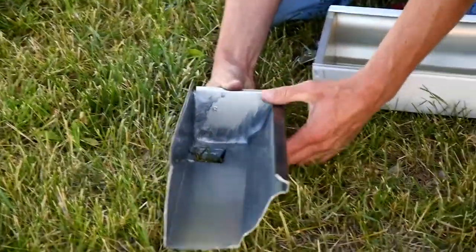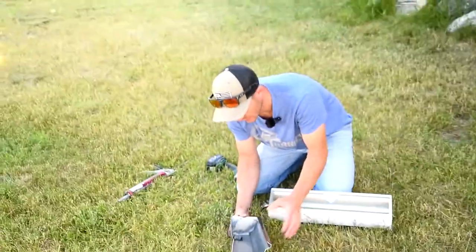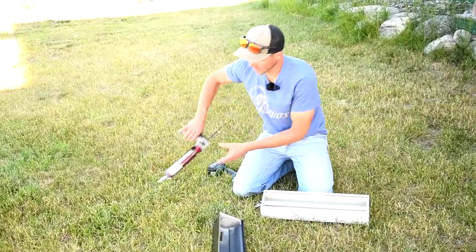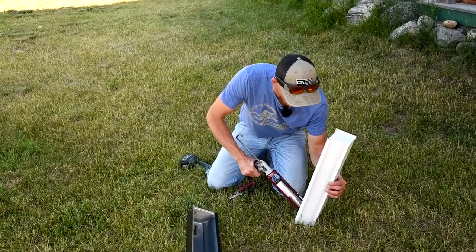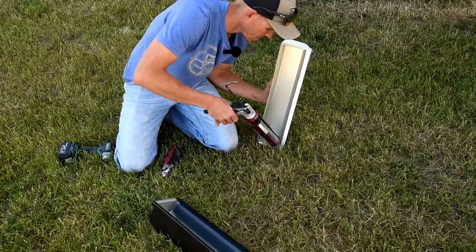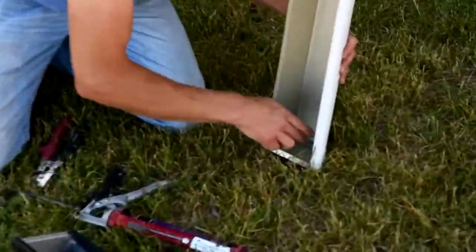So you want to put plenty of extra glue in. You also weld it in with your finger to make sure it's sticking to both layers of metal really well. We'll go ahead and glue this one just to show you how it's done — plenty of glue in there, a nice solid bead all the way. Once you've got a bead all the way in, kind of direct that nozzle in towards the seam to shoot it in there.